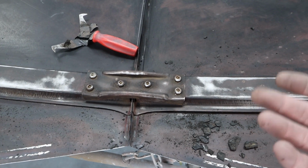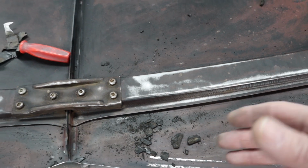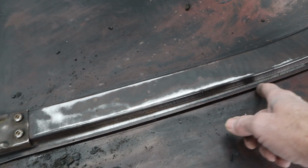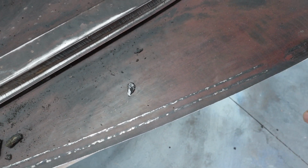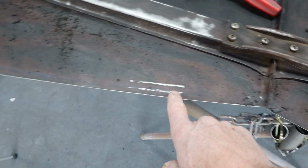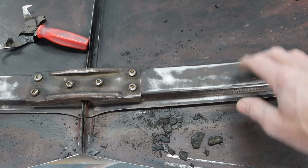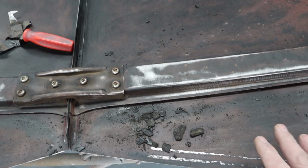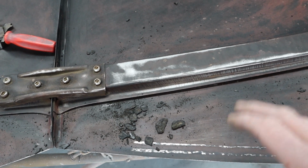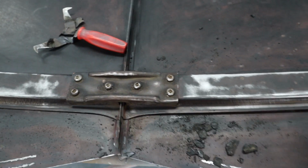So after the hood is completely done, installed on the truck, what I'll probably do is I'll look into what we should use right here, and then we can actually mask this off, put it in there, and then close the hood and let the hood rest, because you guys know it rests right on that little weather strip or rubber strip on the cowl of the cab, and that will hold its shape. And then by shutting the hood and letting that just harden and set up where it's supposed to be, the sheet metal will hold its shape properly to this brace, and then the cab will actually hold the sheet metal where it's supposed to be, and it will look nice. If I did it now, I mean, look, the gap here, I get my finger underneath there a little bit, right here it's tight. So I have no idea how it's supposed to look.